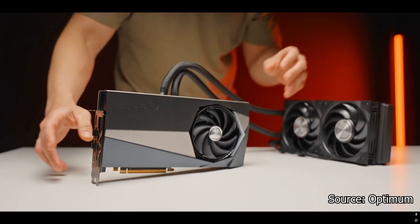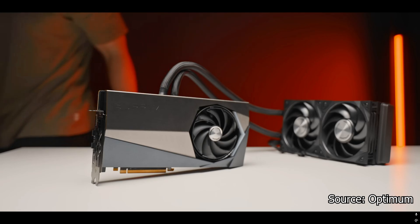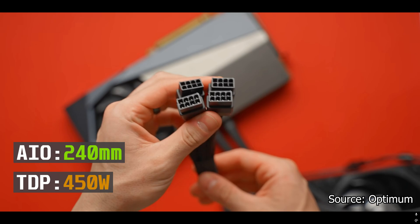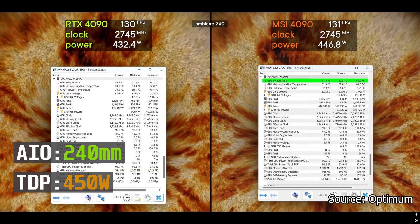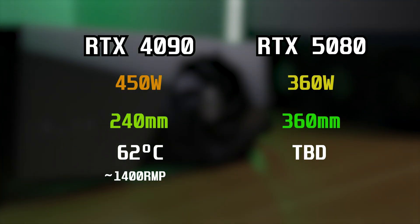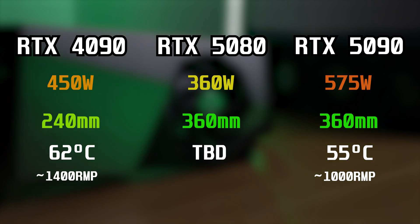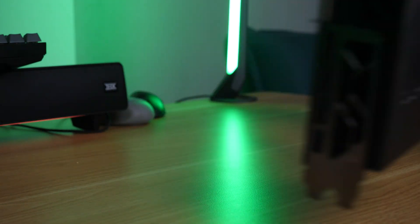But if you add context, it sounds even more interesting in comparison. Two years ago, MSI released a water-cooled RTX 4090. At 450W TDP, it had a 240mm radiator, which already handled the temperature well while still running quietly. So comparing these two models, we have less power consumption and a better cooling system. It's not hard to guess that this happened because of the 5090, which has even higher power consumption and the cooling system was upgraded for it. And to simplify production, our 5080 gets an overkill cooling system.